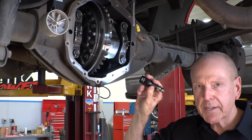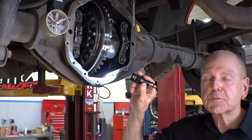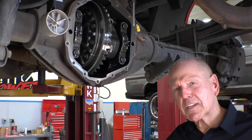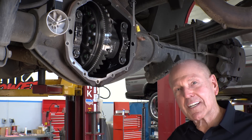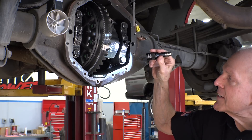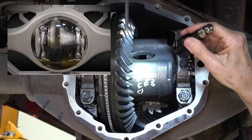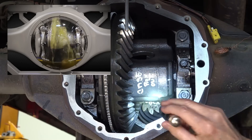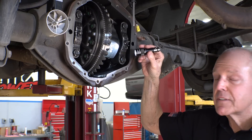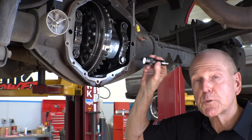The horsepower that comes in here is not the horsepower that leaves. There are frictional and viscous losses going on here. Frictional has to do with rubbing or the interaction between the gears, which hopefully have some lube film in there, but there's still a frictional aspect to the whole system. The viscous — that's the work you're doing to the lube itself. And you don't want to do a lot of work to the lube itself; that's the whole point. As you raise the level in here, you tend to carry more over with the ring gear, which drives it out to the front pinion bearing but also down into the ring and pinion intersection. If you raise the running level, you're going to eat more horsepower right here, make higher fluid temperature right here, and get worse fuel economy right here.